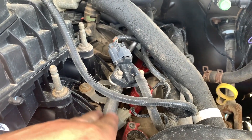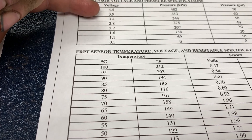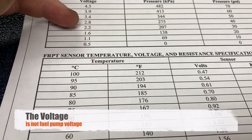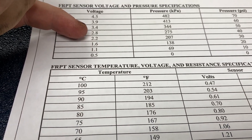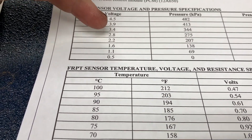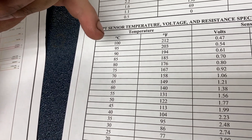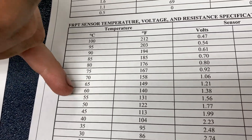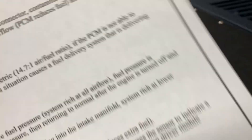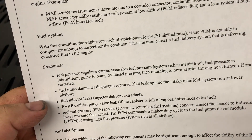On the 5.4 in 2006 — it may vary on different models — the sensor operates off voltage. At about 45 PSI, the voltage is probably going to be around 3.2 volts. I'll see if my scanner can pick that up. I haven't really dug too deep into how the temperature comes into play, but here's the fuel rail pressure sensor data.